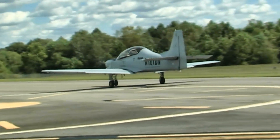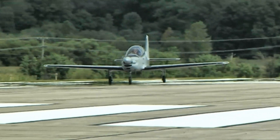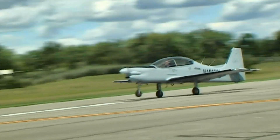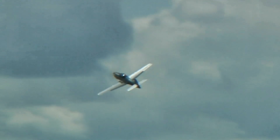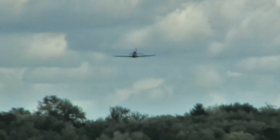The airplane does very well in loops and aileron rolls and is very stable in maneuvers. You can carry about 700 pounds of useful load no problem. When you go with the LSA version, your speed is going to be reduced to 120 knots by pitching the prop lower, and we limit the maximum gross weight to 1,320 pounds. We only put a 100 horsepower engine which will reduce your climb to about 800 feet per minute. Loops are still nice but a little longer and less tight.